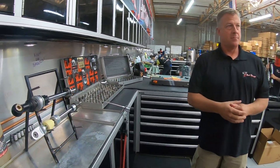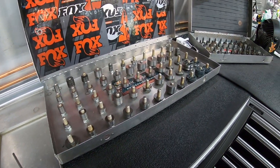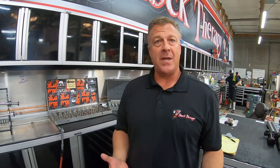The difference between dunes and desert: the desert does not have giant G-outs at the bottom of a 10-story dune that you're running through at 60 miles an hour. That massive G-out at the base of a hill is probably the most stress you can throw at a shock system. Desert tends to be a more plush setup; dunes-only tends to be a little more firm because you have to control that bottom-out resistance in the big G-outs and bowls. Simple answer: dunes are stiffer, desert is a little softer. With today's adjustable shocks you can do both, as long as we know in advance.